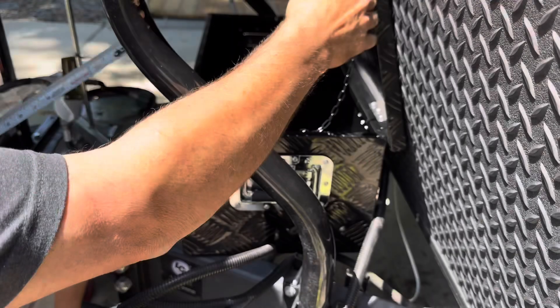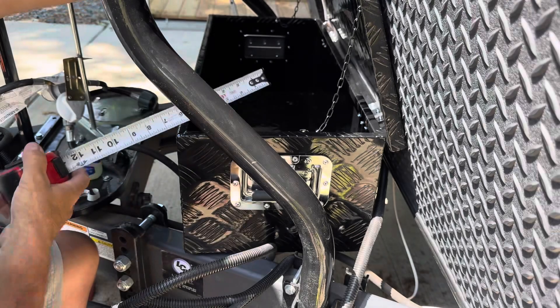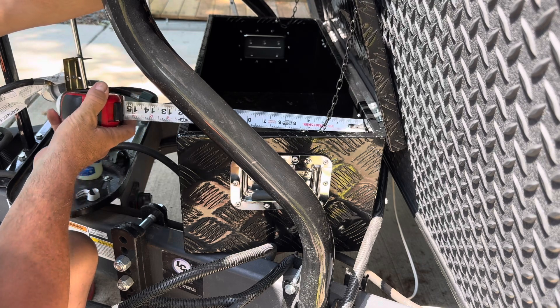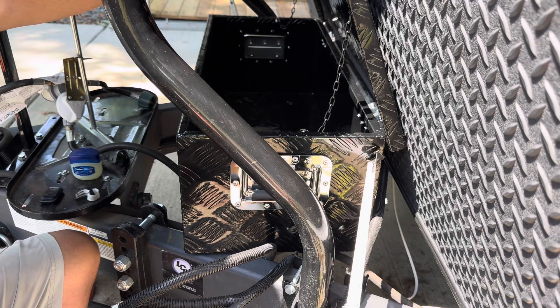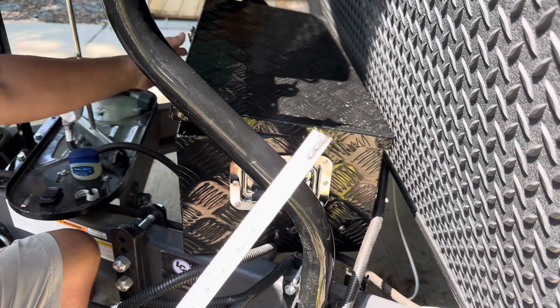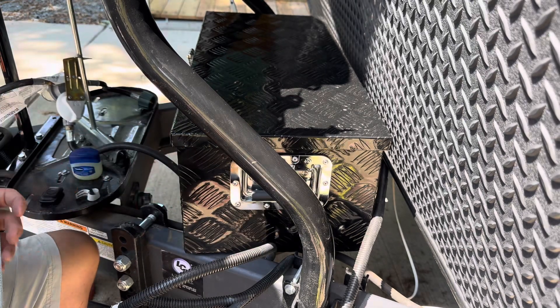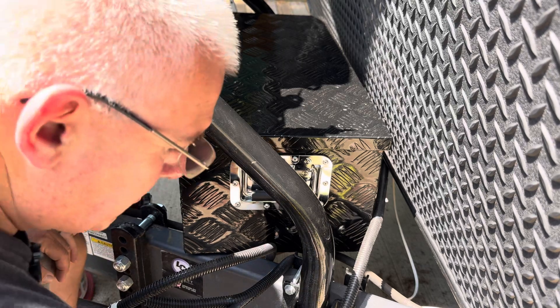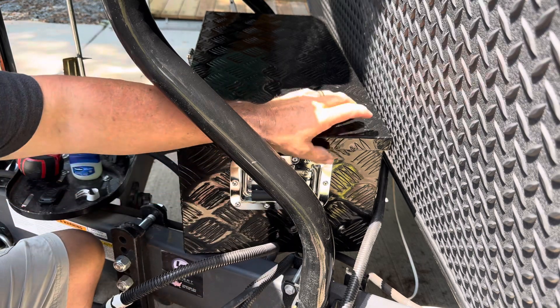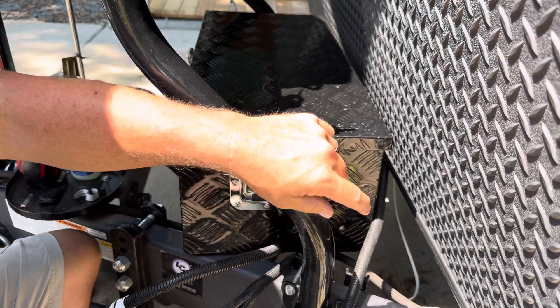First thing I've got to do is make sure I've got plenty of cable, which I've already done. The cable is long enough to curl around and go in this box. I also need to drill a couple holes in the side of the box, put some grommets in, and put the cable in. The width inside is about 12 and a half inches and the battery is about nine inches wide, so I've got an inch and a half or so to play with on the outside edges if I put the battery in the center. I'm going to close this lid so I know I'm not drilling too high, and I'll use a step bit to drill one hole for the negative on this side and one for the positive on this side. I'm also going to drill one in the back for the cable to come through.